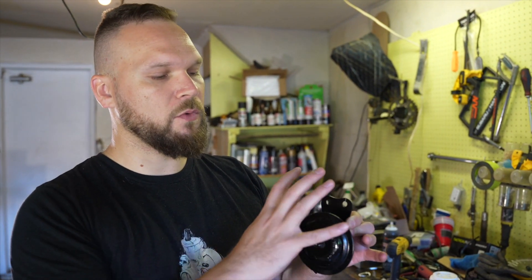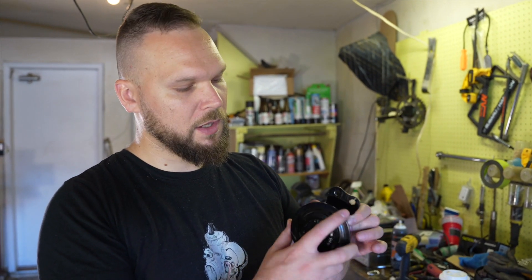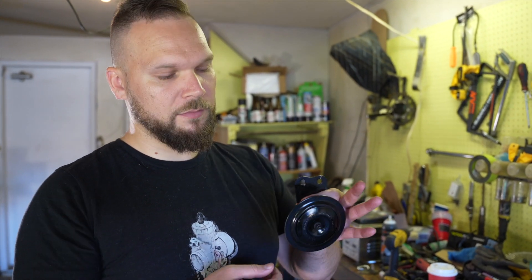Ignore the top part here from where the string was — you're not really gonna see that anyway. The horn is kind of tucked away, but this entire outer ring here was just mild steel grey and this was black but a little bit worn out. It looked kind of gross, and now that everything else on the bike looks pretty, it really stood out as a piece of hot garbage. The horn is inside this cover, so you want to make sure that you don't soak it with paint, that you cover up this hole here, and just make sure that you give these connectors a bit of a buff so that you have exposed metal again before you hook everything up — otherwise you just insulate the entire circuit. But: blacked out horn.